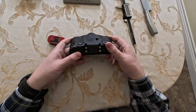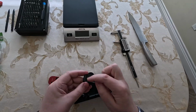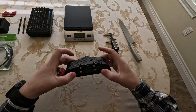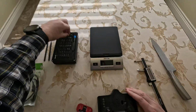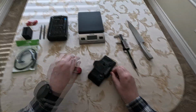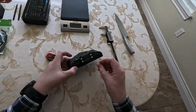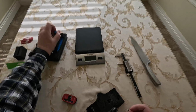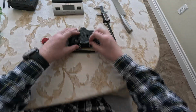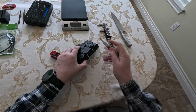It looks like it has probably some hex screws or something in there that I can tighten. It's actually very tight even without tightening those, but we can check real quick what it possibly is. Let's take a couple bits out. Yeah, it seems like it was this first one here. So that's a 2 millimeter. So it looks like if you do want it to be really firm, just make sure you push it real good. You can see that it's parallel, and just tighten it just a little bit. Okay.